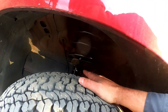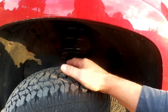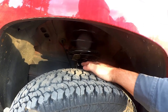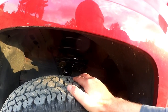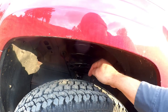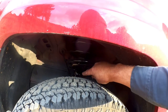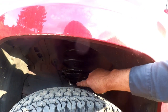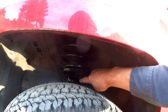It is possible to hammer that flat and cut the liner away for a little more tire clearance. However, up here is the lower spring seat for the strut — when the tire moves up and down with suspension travel, this moves with the tire. So this gap is pretty much always fixed, and it's not actually all that much space. If you lift the car with a suspension lift, the lift happens further up — not at this location — so even with a lift, you can't realistically fit a larger tire than this clearance allows.